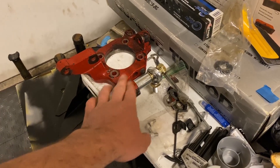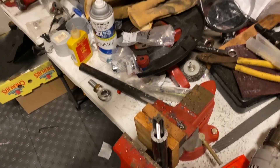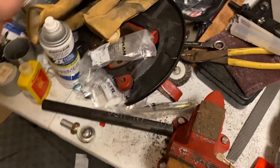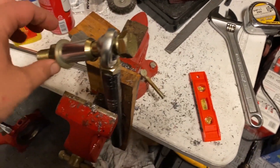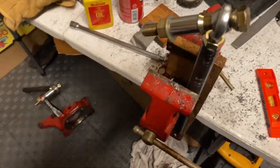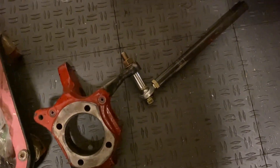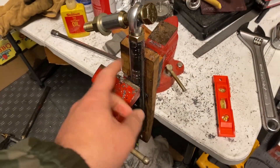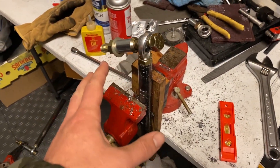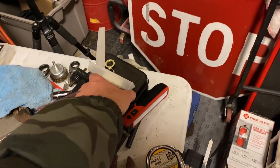I also drilled this hole out to 5/8 to test it. I'm going to have to drill the holes out on the two knuckles on the car to run this setup. I got the other rod drilled and tapped - thank god for the $8.99 eBay taps. This guy is locked up on the hub and we're ready to go. I know I won't need the full 12 inches, so the next move is getting the inner tie rod onto the car.